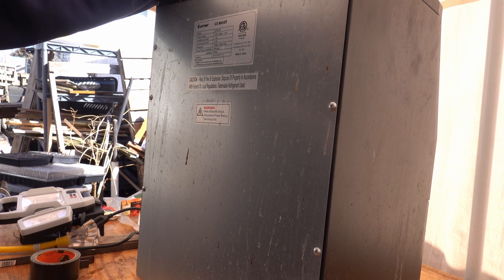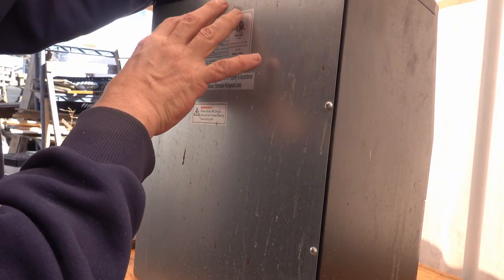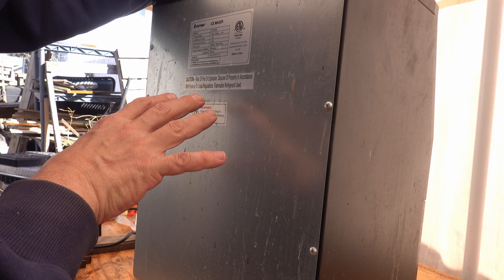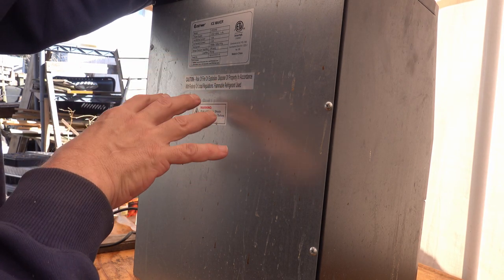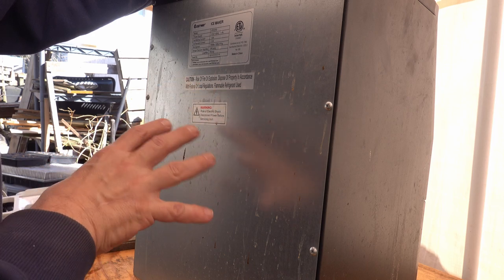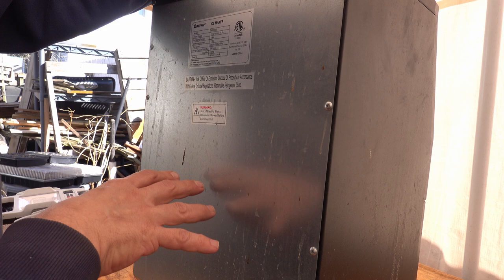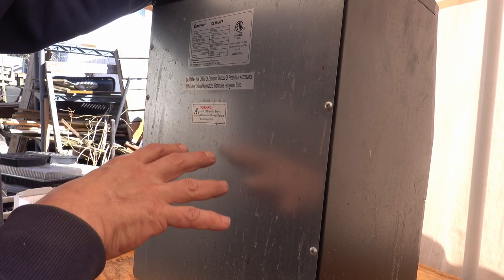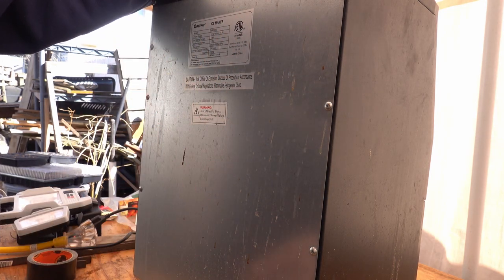And I think what happened is there's a valve in here that goes from the water reservoir into the cooler. And I think that valve has become dirty. So I want to check and see if I'm correct on that. Otherwise, see if I can fix it. So what was happening is the water that was in the reservoir was just draining through into the ice tray.